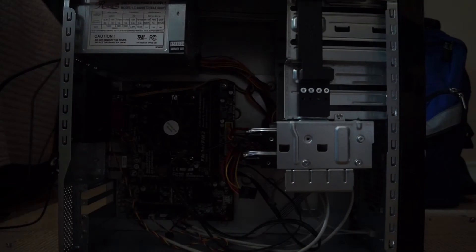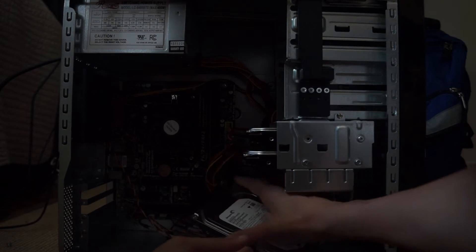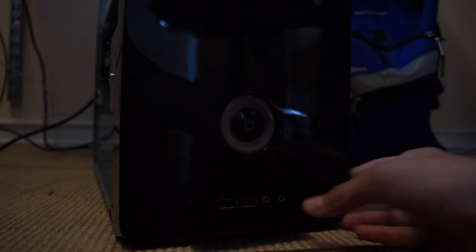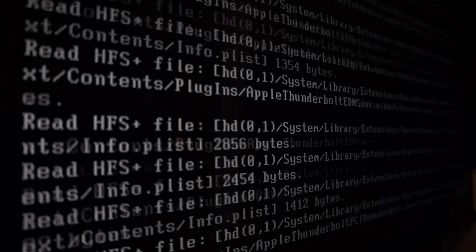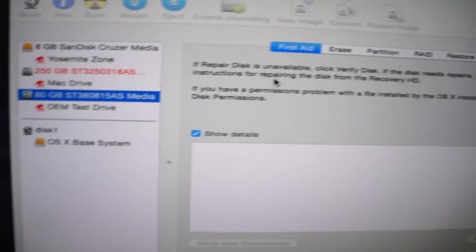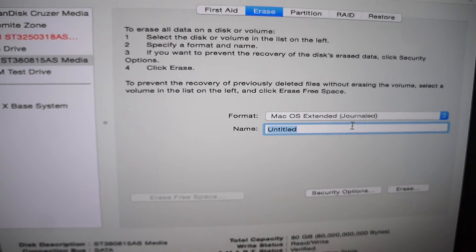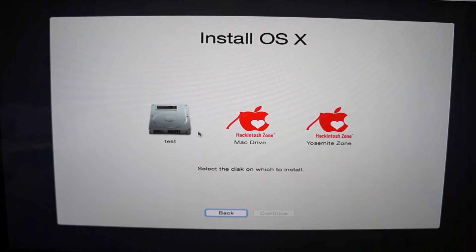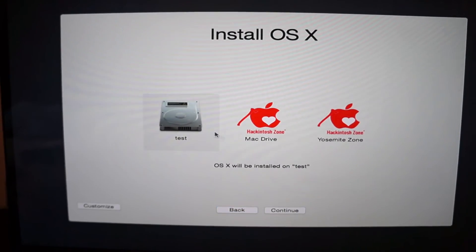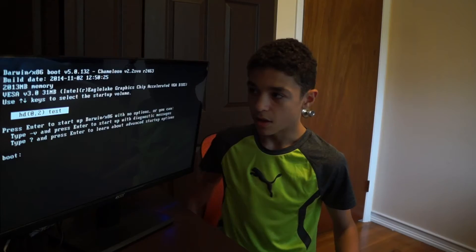That is what I attempted. I removed the hard drive from the ThinkCenter and temporarily placed it into my PC build, which already has OSX installed on it. Booting from the bootable USB wasn't an issue, and I quickly arrived at the Darwin Chameleon bootloader. After putting in my boot flags, I arrived to the setup. In the disk utility, I formatted the drive as a Mac OSX Extended drive and named it 'Test' so I wouldn't confuse it with the other drives. After this, I finally began to actually install OSX to the drive — it's a long process, so I'll just skip it.